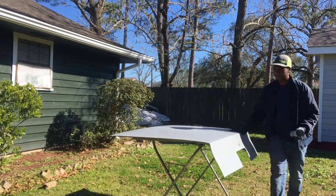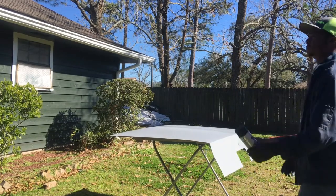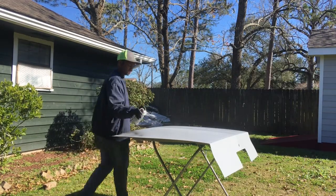Today's video, I'm gonna show y'all how we block sand our parts for our Monte Carlo. Just got me some flat black paint. I'm gonna apply it to the surface, and I'm gonna hit everything with some 320.